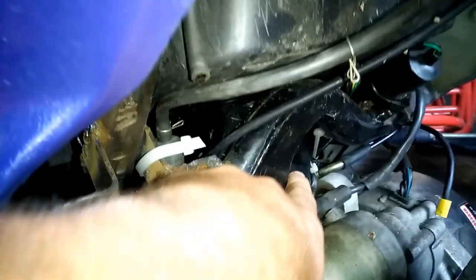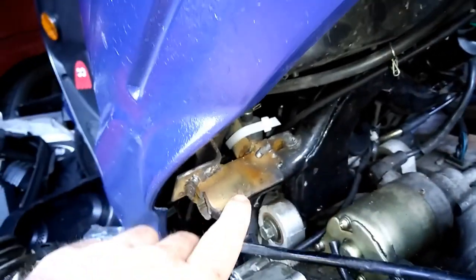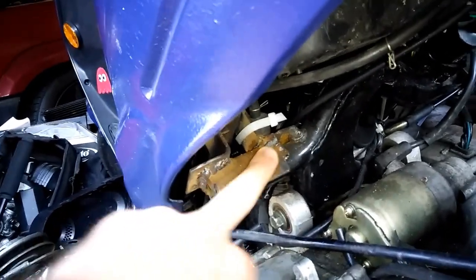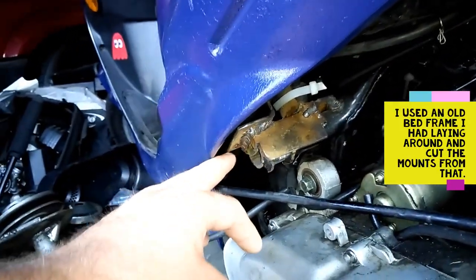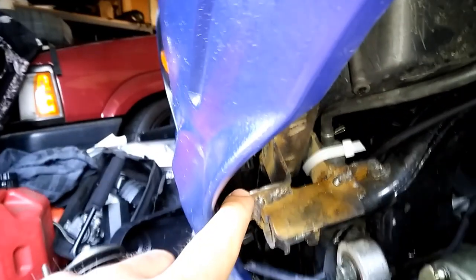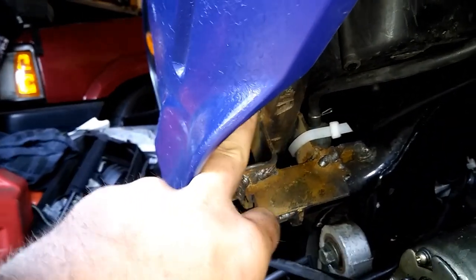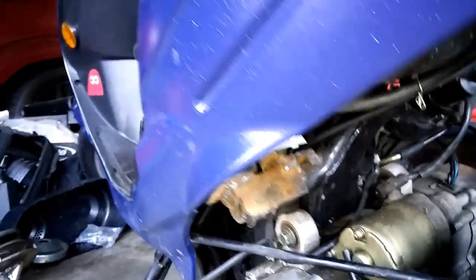It's got a little opening here for the carburetor intake to come out. I just run pantyhose zip-tied on. I still need to paint this — as you can see it's getting a little surface rust on it. But what I did here was took some angle iron and welded it to the round pipe, cut the round pipe down a little bit, and then I took two pieces of angle iron and placed them against the flat top here and then just welded them up alongside the frame rail.